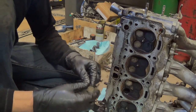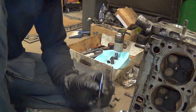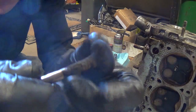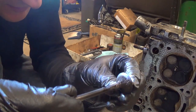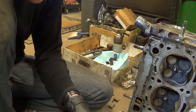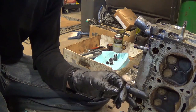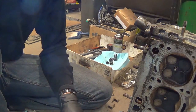Here we have valves off of cylinder number two. That one I cleaned - what was it, 10,000 or 20,000 miles ago when it initially had the misfire code? And it doesn't look any better than the valves on cylinder number one - that's kind of insane. That's why we're doing them all. You would think you could just do one and four, but nope. Our compression check actually showed low compression on number three as well. So this problem is across the board.